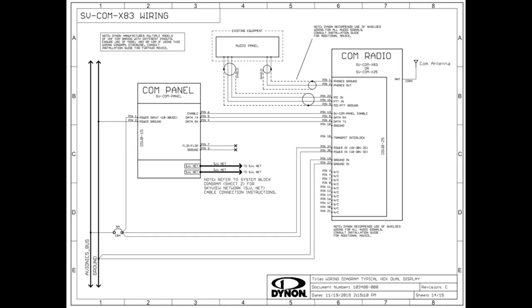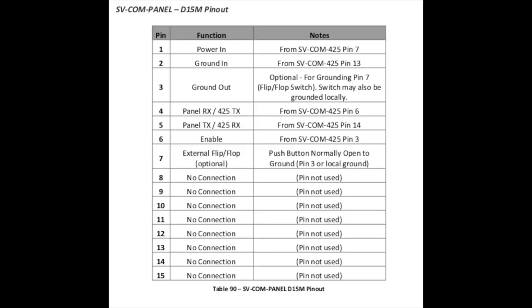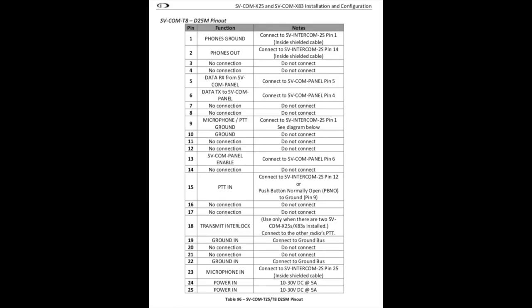The wiring diagram shows both the control head and the remote comm unit sharing a single power source, and I would assume that the intercom box — which we'll talk about here in a minute — could also join those two on that circuit. If anyone knows the answer to that, let me know in the comments below. The connections between these units couldn't be simpler, with your typical data in and out as well as power and features like flip-flop and push-to-talk mixed in there. Remember to use shielded wire anytime it's carrying an audio signal to prevent noise in your headset. Dynon does a great job at suggesting grounding layouts to prevent dreaded ground looping issues, and detailed pin information is clearly laid out for every plug.